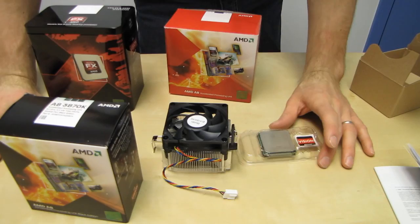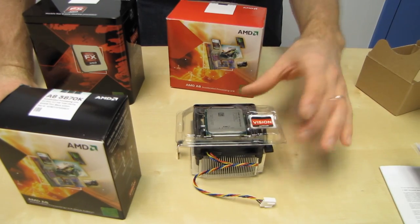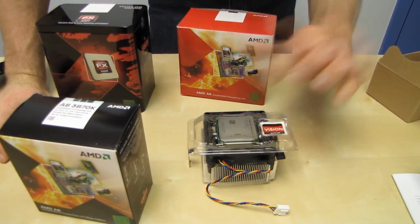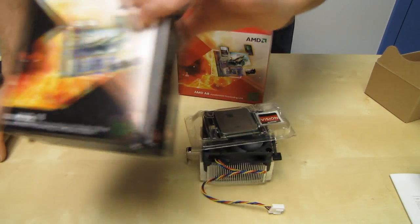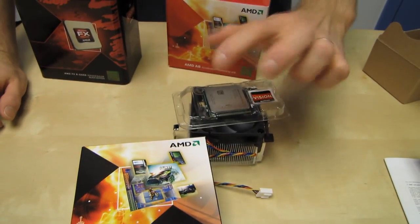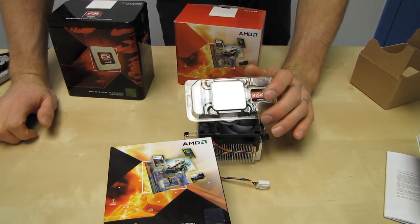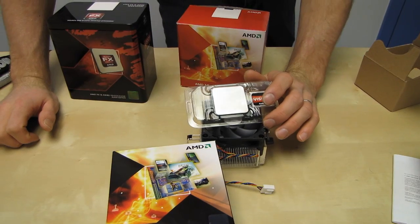How does it compare to the competition? Intel has their Core i3 dual-core processors with hyper-threading in some cases. In applications where you need faster but fewer cores, this doesn't stand up as well. However, if you need the extra cores or the graphics power — and they promote games like Dirt 3 on the box — AMD's APU absolutely smokes an Intel Sandy Bridge processor with its integrated HD 2000 or HD 3000 graphics. I've done a video on this comparing the A3850 directly against the Intel 2105, which you can find on my Linus Tech Tips channel.